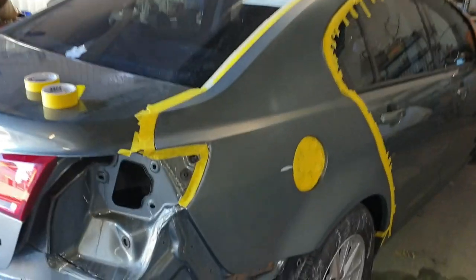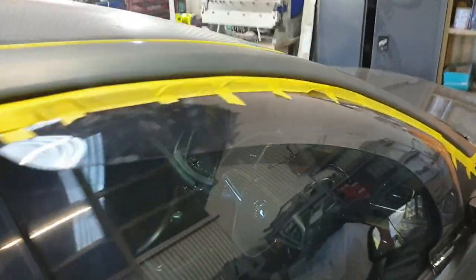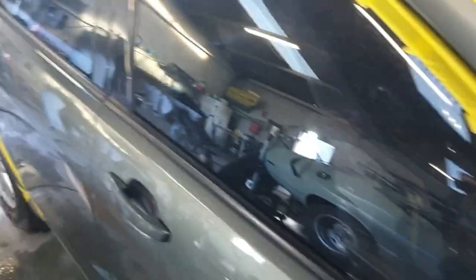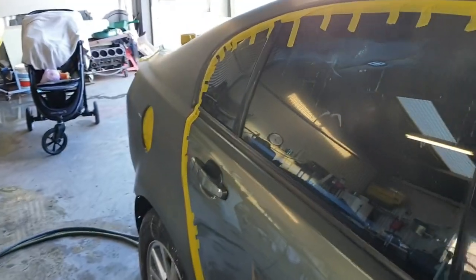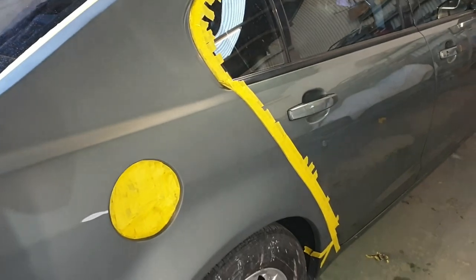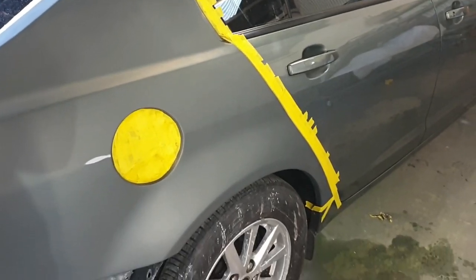I've just been back masking, got my J tape down, my window seal taped up, pulled it down and taped it that way. If you're going to paint the quarter panel, you've got to paint the whole turret as well - not the whole roof, but the clear has got to go all the way up and across the top because there's nowhere to really join it.